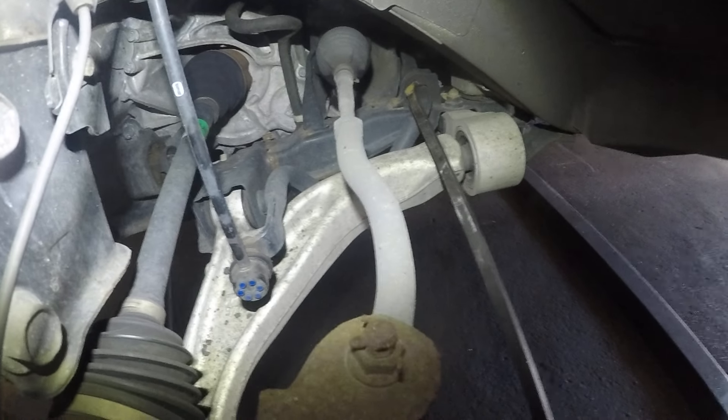In our case, I don't see anything. Check your ball joints, see if there's any movement — pretty much no movement here, no movement anywhere. I did recommend control arms and everything to this customer, but right now the problem we're addressing is the bushings.